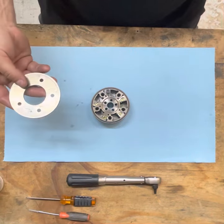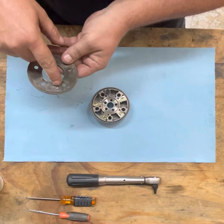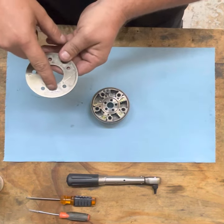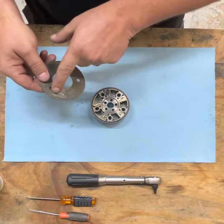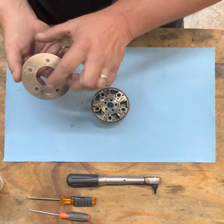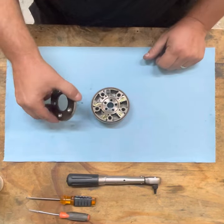And for this, you can see here on the back lid that this had a failure at one point. So the old washer broke and the spring was just rubbing on the lid back and forth. So we want to avoid this area because we don't want our brand new washer riding on this surface, which is a little bit rougher. So we're going to make sure that this rougher part is up above and not interfering with our new washer.